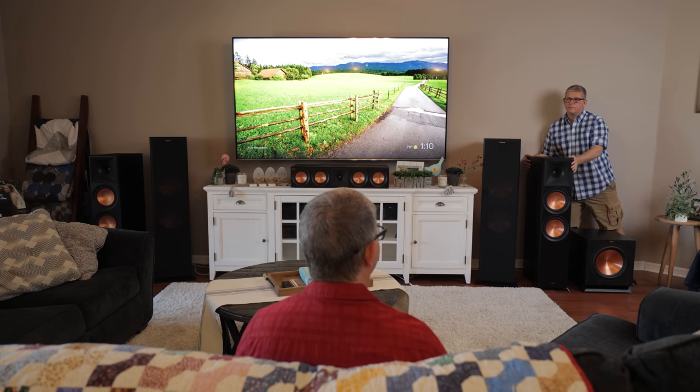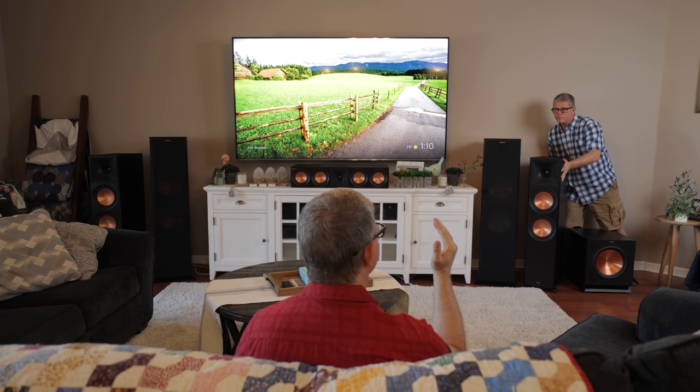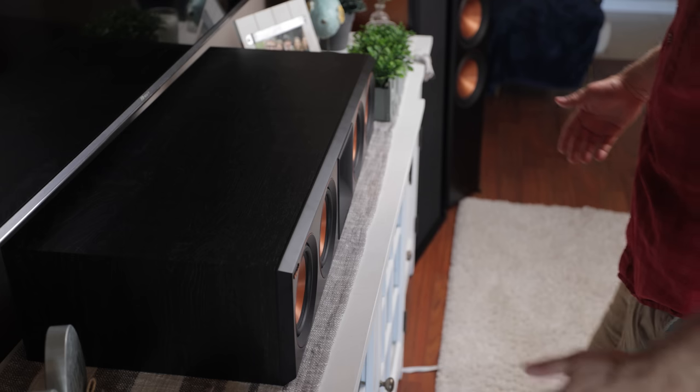Connect the power cable and we're done at the back of the AVR. I have a comprehensive walkthrough on how to install an AVR linked in the description. Now let's align our speakers. I typically like to have the tweeter aimed slightly behind my listening position — aiming your speakers toward your listening position is called toe-in. Not every speaker requires toe-in, so play around to see what gives you the best sound. Even small changes in angle can make a huge difference. Also make sure the right and left speakers are in line with or slightly in front of your entertainment cabinet to reduce unwanted sound reflections.